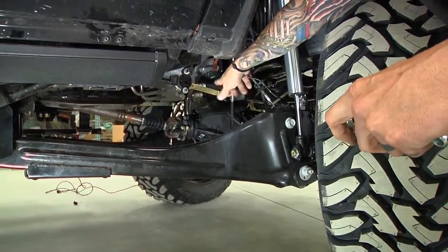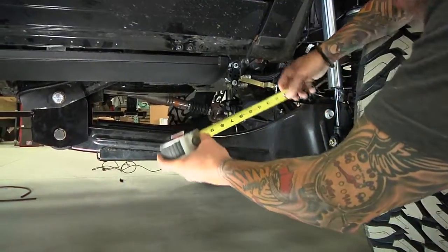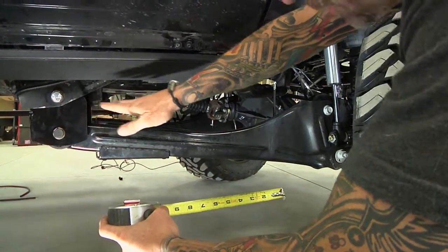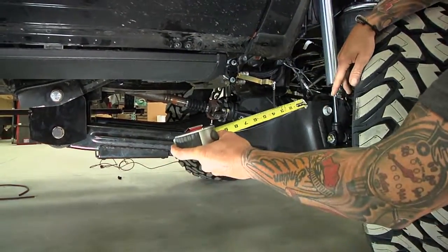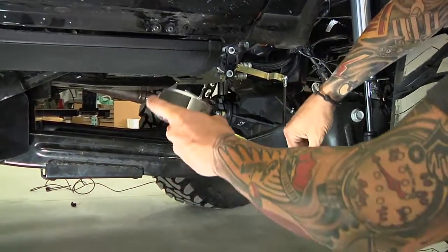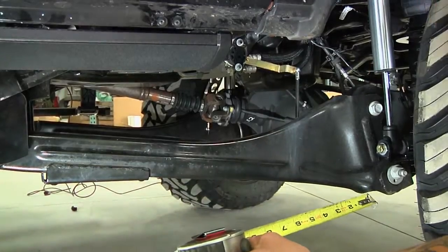The bar is coming straight out at ride height — that's going to give us the sweep we need. These sensors have a wide range of sweep, so we don't need to have them real close to the pivot point. They can go halfway or a little bit forward like this one. On this particular truck, we've got it about 70% toward the front. We've got a lot of sweep, and it's going to work really well in that position.